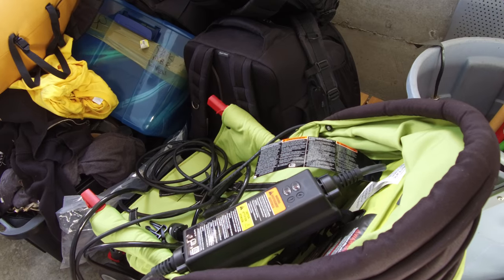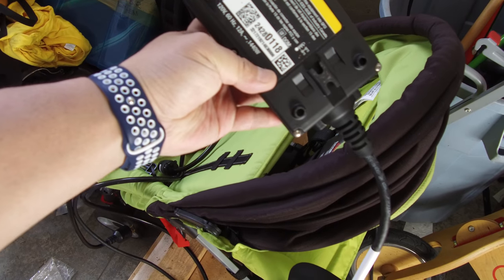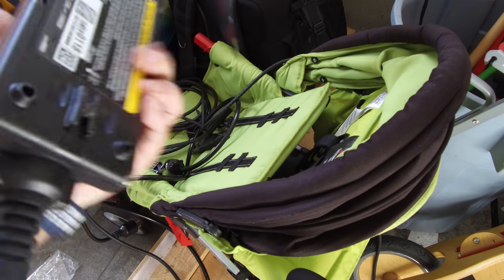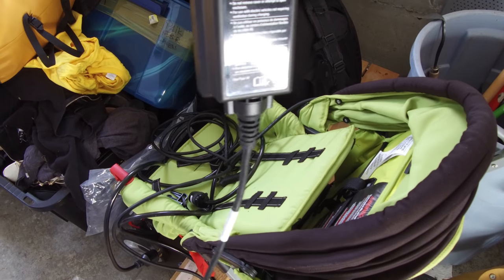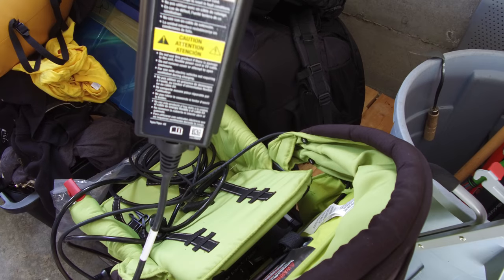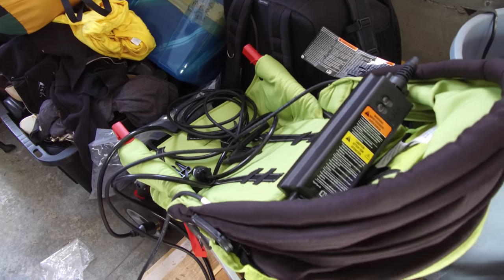What's interesting is Chris said that by evaluating all the wiring inside, it looks like even though this is rated at 120 volts, 60 hertz, 12 amps — so 1440 watts, or 1.4 kilowatts — he basically said this should work in a 240-volt outlet. So this can handle 240 volts without any modifications to the actual EVSE. You don't need to mail this out to EVSE Upgrade or anyone like that. This comes wired and ready for 240 volts.